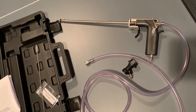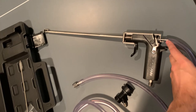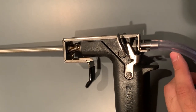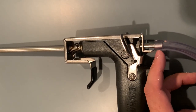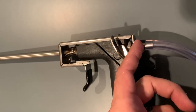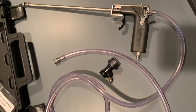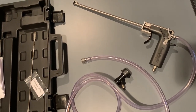All you have to do is connect the liquid line into the liquid metal tube, which is just a pressure fit. When installing this, make sure not to go over the metal clips here — this is how you take it apart, by lifting up — so make sure not to go all the way to the back, just enough. The gas line can then be connected to your CO2 regulator in your kegerator.